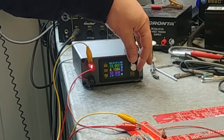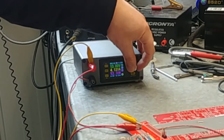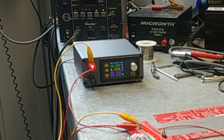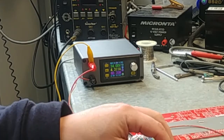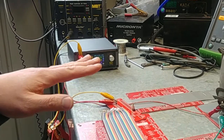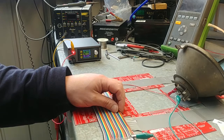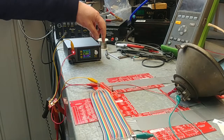I'm going to increase the current up to a 4.5 amp limit and increase the voltage a touch more. That's at 14 volts now pulling about 4.3 amps. At 4.3 amps there is a very slight but noticeable increase in temperature on that wire. It's worth noting as well that this is in effect at 100% duty cycle, which is not something you're ever going to be running with fuel injectors. So it's worth keeping that in mind depending on what target duty cycle limit you're going to be running at.